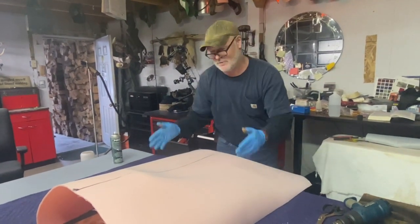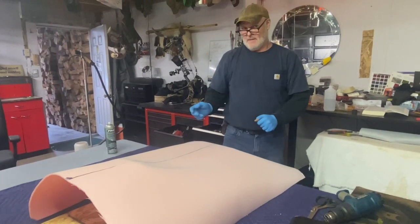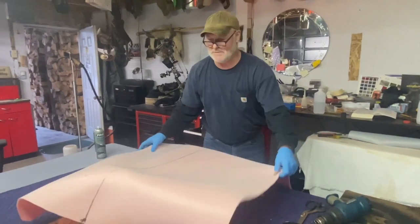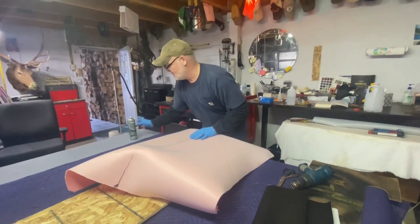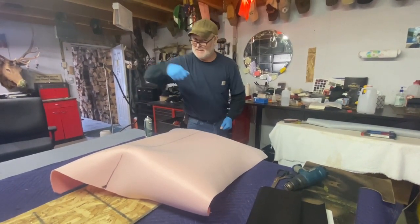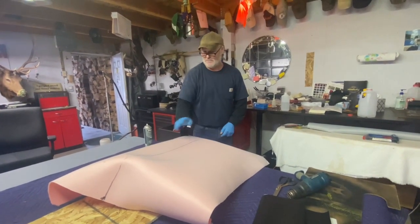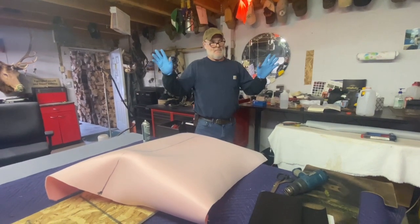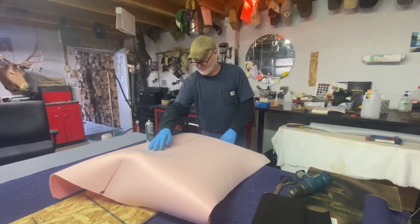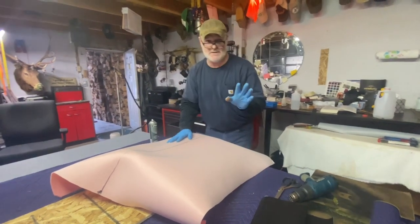What if you don't have enough and you just barely have enough to cover this seat? That line's imperative. And then the rest of it isn't glued down, and the spray foam is still wet, so you could still pull it up. But when foam to foam comes, especially these closed-cell foams and then this scrim, oh, they lock quick. So it'll give you a minute to go, oh, and pull it back up and readjust, okay? But you only got a second.